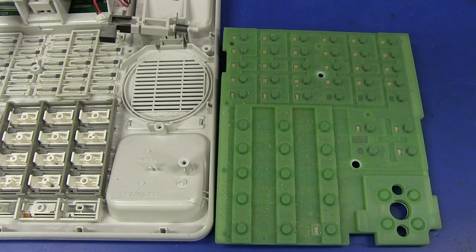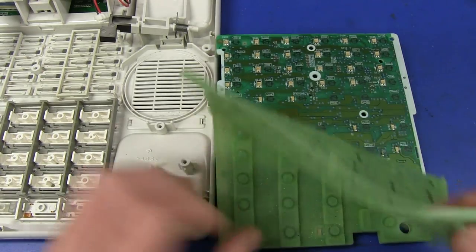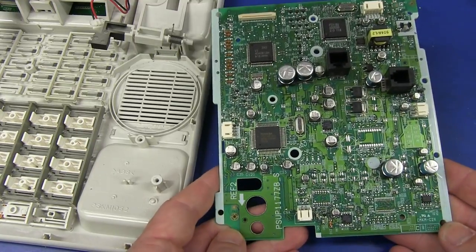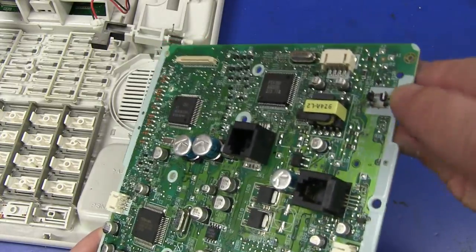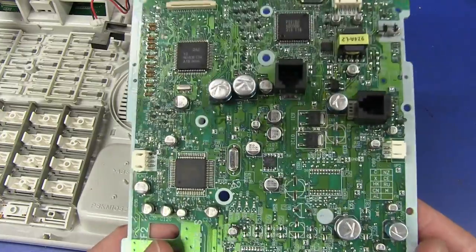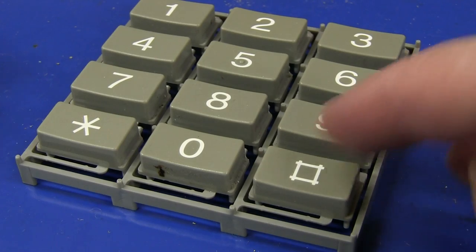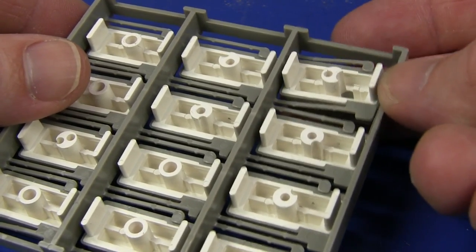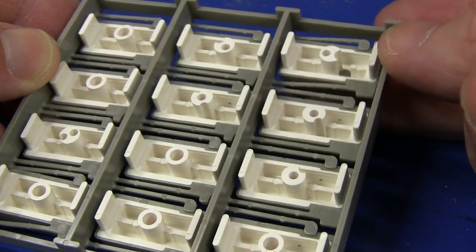The board just unscrews out of there. The matrix and the LEDs — surface mount LEDs to light up the individual keys — all surface mounted on the bottom of the board. True single board solution in that phone, very nice. Only a double-sided layout, that's really all they need. You can forget the chips — these are all proprietary jobs, don't even worry about trying to salvage those. You can see how they manufacture these keypads on the little lever arms, all part of one big plastic frame. Once you've got that down pat, it's a very cheap and efficient way to get a nice tactile spring feel on your keys.